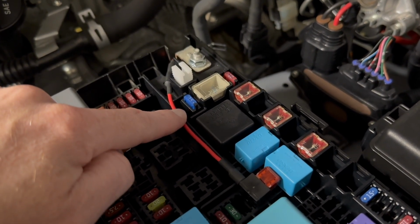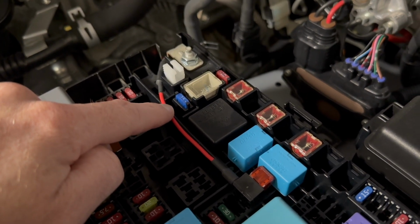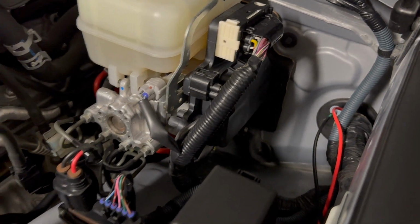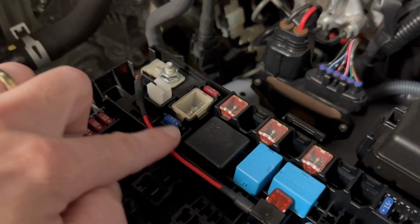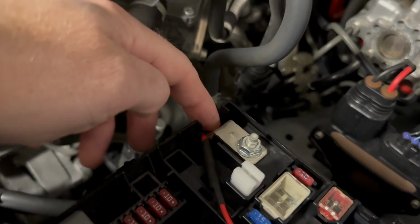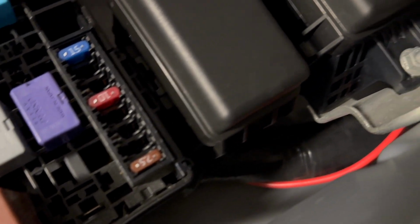I looked at the wiring diagram online and found where those green wires are most easily accessible, and that's inside the cabin fuse box under the steering wheel. So I need to send this power wire in there, into that fuse box by the steering wheel. As you can see, this wire drops down through this access hole. I send it down and under the box, comes out underneath there, and I run it alongside the wiring harness, and then I send it through the grommet here.